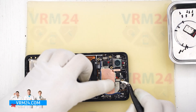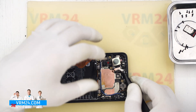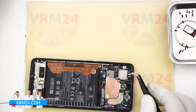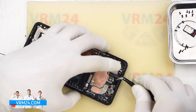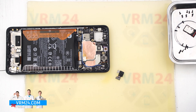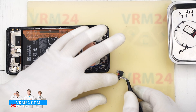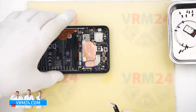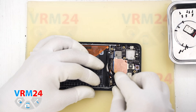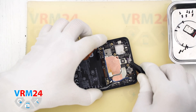Next, we move on to the motherboard. First, we disconnect the cameras. We detach the rear cameras — they come off easily — and set them aside so they don't get in the way. Then we disconnect the front camera. It is best to cover the front camera lens with a special film to prevent dust or debris from getting on it, and set the front camera aside. After that, we disconnect the interboard cable connector and the display cable connector. We also need to disconnect the coaxial cable connector and free the cable from the clips holding it on the motherboard.